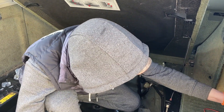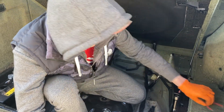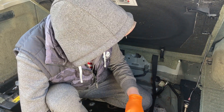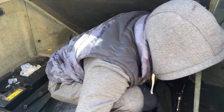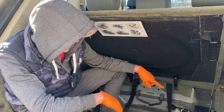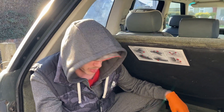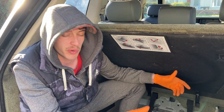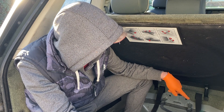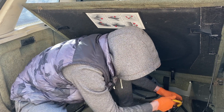Put my relay back in, keep my piece of copper wire handy just in case. This is all set up and only took me about five minutes. Basically I'm just jumping a piece of wire on that relay to make the compressor come on. I could probably make a better wire with a switch on it, but the relay has to go back in anyway for the air suspension. This is now adaptable — I can just unplug that and plug in an airline.